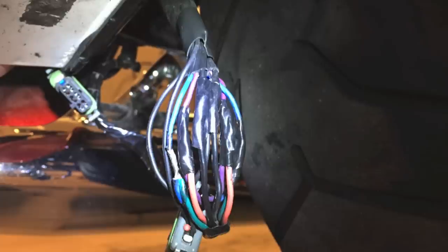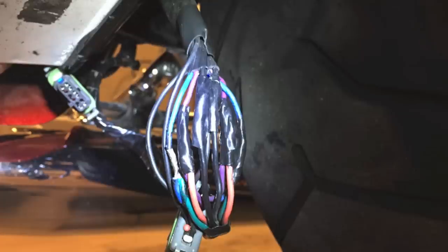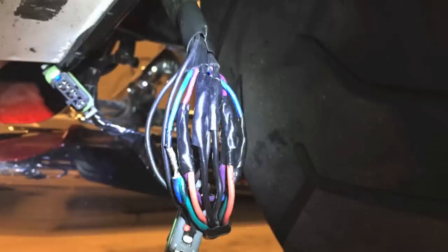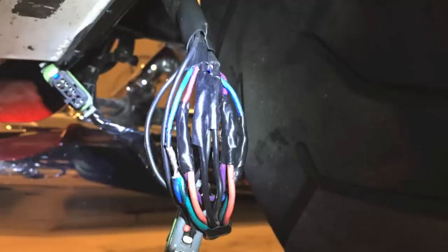In the process of shooting the wires, you'll trim back the black covering from the harness to expose them. Once you've got it sorted out which ones are appropriate for your application, about an inch back from the harness I began trimming the wire about a quarter inch of insulation, being careful not to cut through the wire. As you can see here, I staggered them — had the blues pretty much side by side, the purples side by side, and the blacks side by side. About a quarter inch trimmed, and then with my wires that are going to be going forward, ensuring that you have plenty of length of wire with excess so you can trim it back once you connect it on the other end to your tour pack harness.